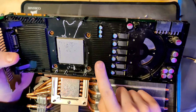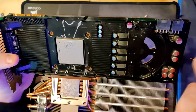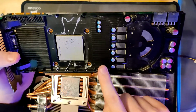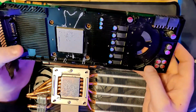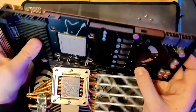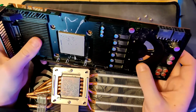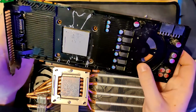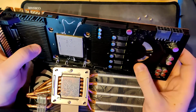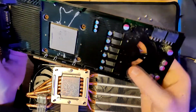I saw my GTX 580 is like, I have one 580 with VRM cooling and one without, and the one without clocks much worse for memory. And then when I managed to cool the memory a lot on the card that overclocks worse, it actually clocked better. So memory cooling on this seems to be very important. And all of my Fermi cards are Samsung, so this is the same memory IC type. So I guess from the extra cooling, I'm going to see a couple extra megahertz.